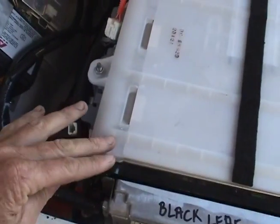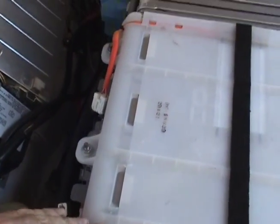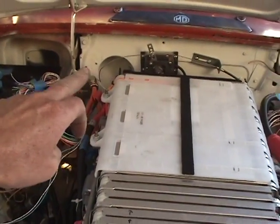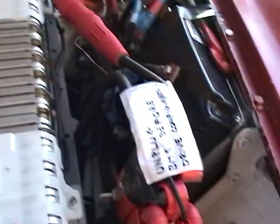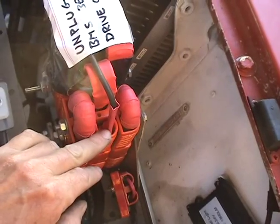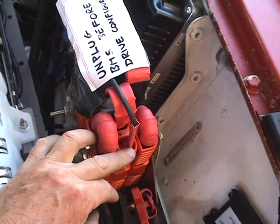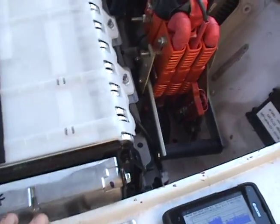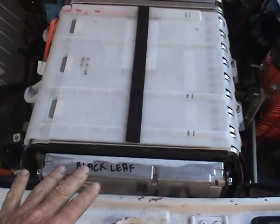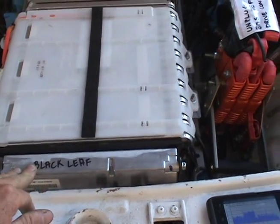So normally it's 100 volts and then another 100 volts, but currently this is actually wired up as 0 to 200 volts. And the back one is also wired up as 0 to 200 volts. They're also wired in series, so essentially all the battery packs are wired in series so that we're charging at 400 volts, which is the standard Nissan voltage.